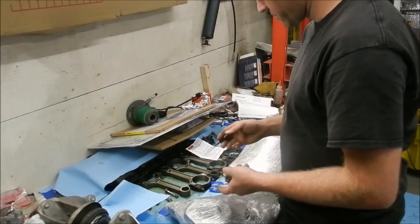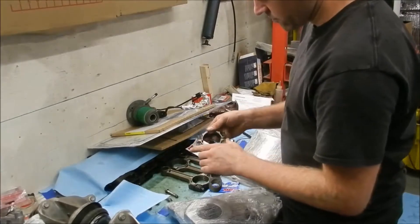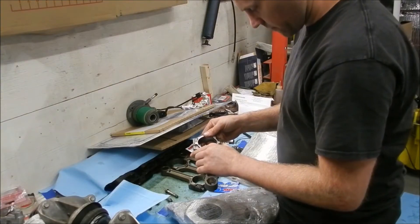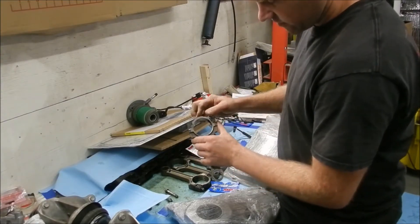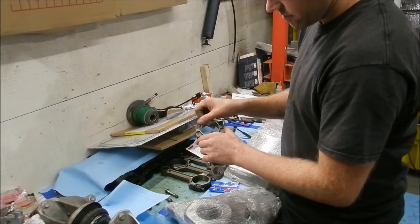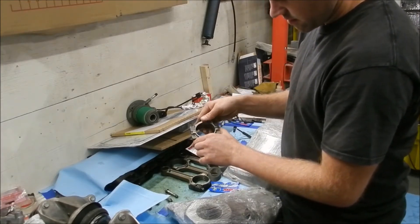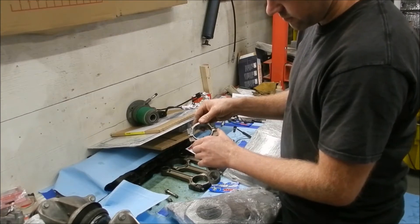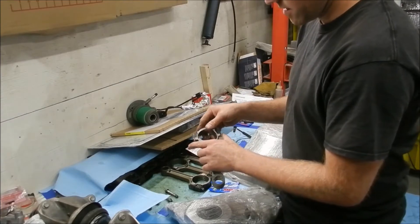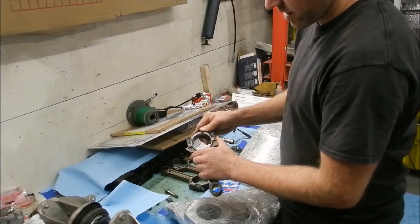Here's that rod cap. Now here's that cracked rod thing I was talking about earlier. So see, it's seamless right now — you can't even hardly see the seam. But here's the crack, right? Now let's do this. Look at that — not even close to a match. It is so far off. So you cannot screw these rods up. And if they're off at all, you can see the crack. Once they're on the right spot, the crack pretty much disappears.